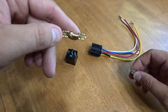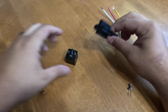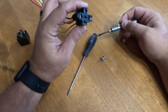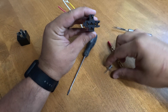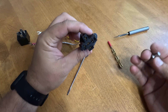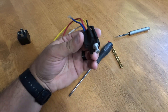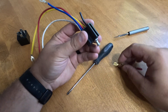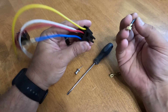If you look at the back of this pin you'll see there's a little raised tab — that's the locking tab that keeps it in place. To remove it, all you need is something small that can be pushed in. Looking at the front of the connector, you'll see a slot. In this example we're using a thumbtack: once you press it into that slot, it gets in between the locking tab and the housing, and now the pin should just pull right out.